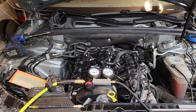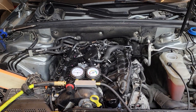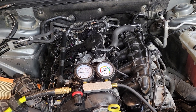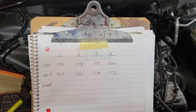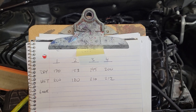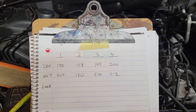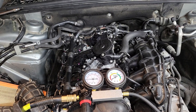Working on a 2010 Audi A4 with a 2.0 turbo. We've got problems with rough running and random misfire codes. We did a previous compression test — cylinders 1 and 2 have low compression, and cylinder 2 is right at the cusp of not meeting minimum spec. We're going to do a leak down test to help figure out if it's a valve problem or where it's leaking from.